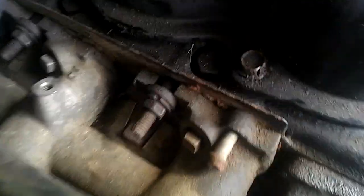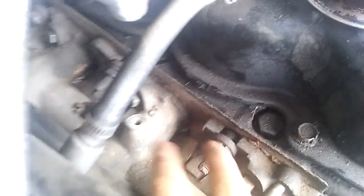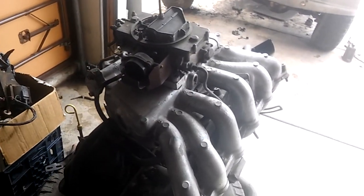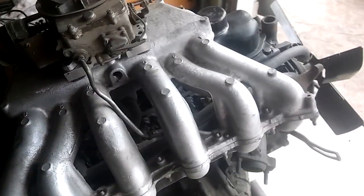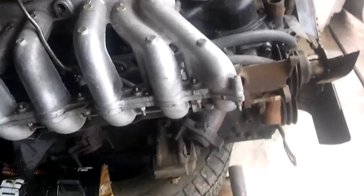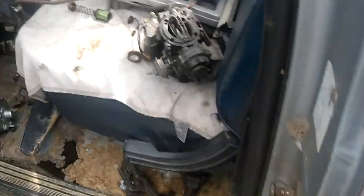And this intake — it's actually a 1996 Ford inline six truck intake with fuel injectors. Somebody plugged them off and cut a hole in the top for the carburetor, and got that all worked out. They said it ran good. It's also got dual headers, so this is going to be a lot more powerful than the original setup with the small one barrel carb.